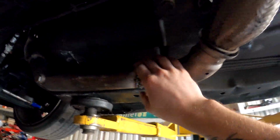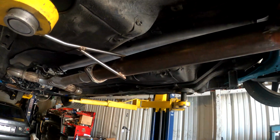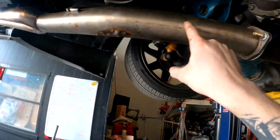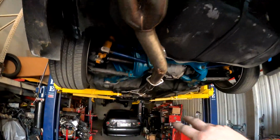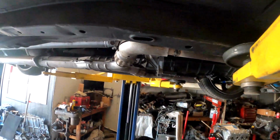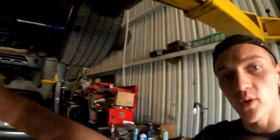Same thing on this side, and then I lined it all up with an ISR long pipe that comes with a 240 blast pipe set, and I ended up taking out the little tiny angle that's in it and angling it straight so it would come back and line up the blast pipes. So it all works, none of it leaks, and it's all hooked up properly, and most importantly, it no longer drags on the ground. That's not going to be an issue. So this car will be drivable now.